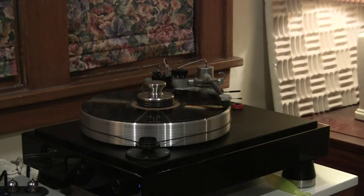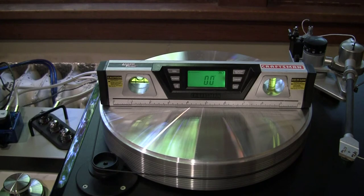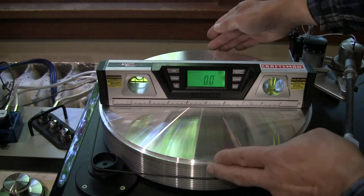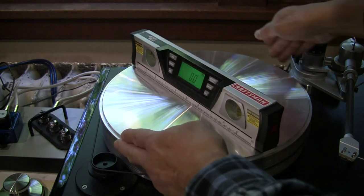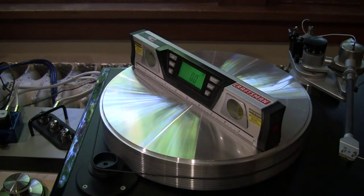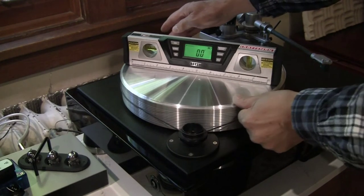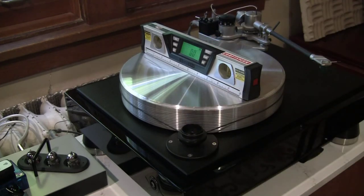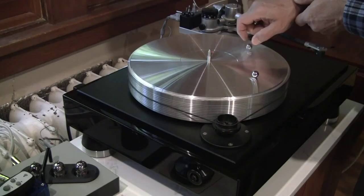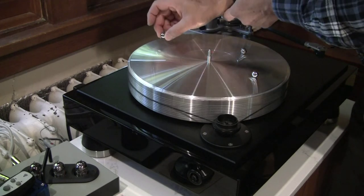Before we set these parameters, there is one parameter that is more important, in my opinion. You have to make sure the turntable is level. Even if your turntable does not have VTA and azimuth adjustments, just leveling your turntable platter will let gravity work in applying even downward force from the needle to the record groove. After you have leveled the platter, try the marble or ball bearing test. Place some on the platter and see if they roll off.